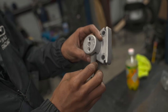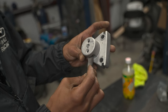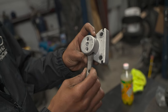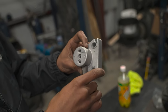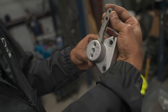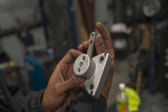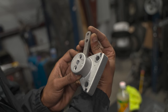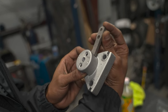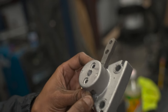Once you get your pin removed and your lever arm freed up, you're going to flip it to the top. When doing that, make sure you keep your directional arrow facing the flat side of your caliper — so it goes to the top with the arrow facing forward. The reason being that once you engage your brake you'll be pulling on the lever, so the arrow shows you the direction it should be pulled.